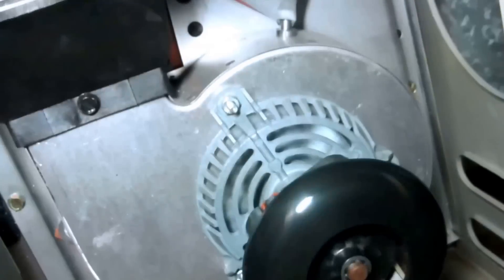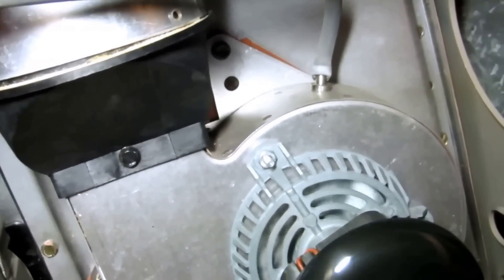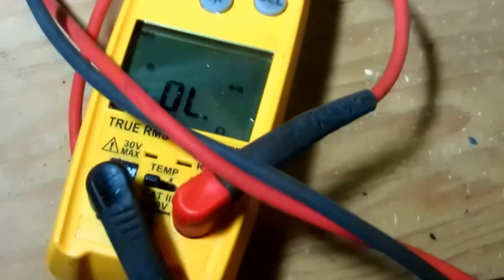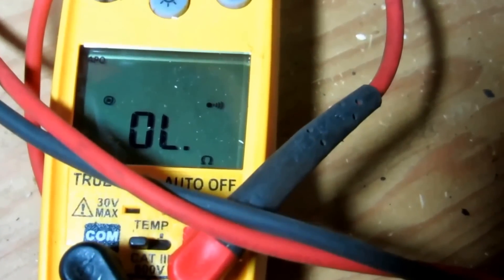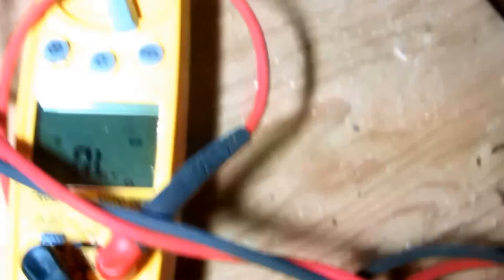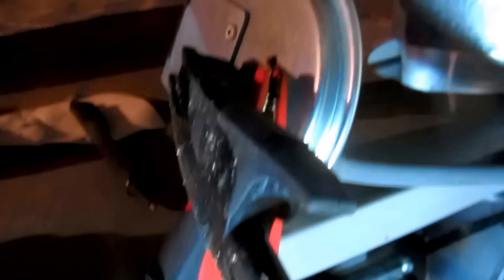Alright, I found the problem. Right with that hose connected in there was some dirt on it, in that connection. I pulled it out and cleaned it out with a piece of wire. I got my vacuum switch over here now — I got it on continuity to make noise. Pulling in now — that's what the problem was. I'll put it back together and we'll fire it up.